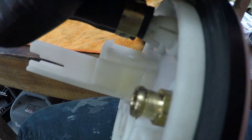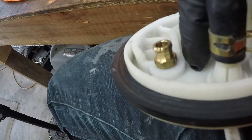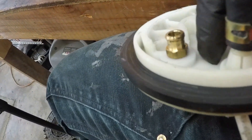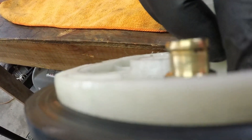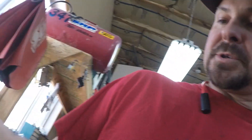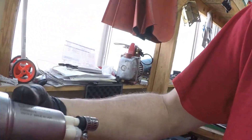They're the perfect height and depth for this kind of situation. It looks like he cut off the barbs — you can see a cut mark right there because he left a little bit of a step. I usually go all the way to the edge but it is just plastic there so that works out fine. He's got a super short little hose here, and this is a Walbro 450 — that's going to be his primary.